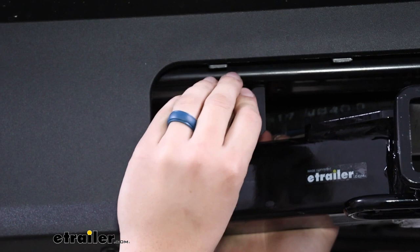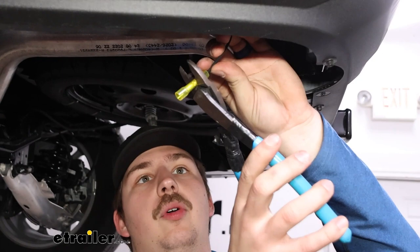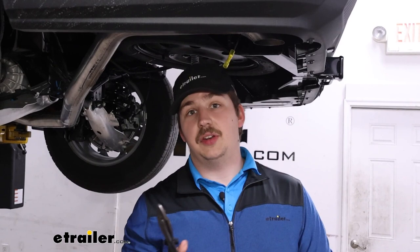Now all we have to do is route our power wire all the way up to the front of our vehicle. For our black power wire, we're going to start by crimping on a butt connector to the end. Your kit does come with some, but I'm going to use heat shrink because that is a more watertight connection — same way we extended that ground wire earlier, making sure that connection is good. Your kit does come with a good length of black wire to extend this all the way up to the front. As a general rule of thumb, avoid any hot or moving parts. Things are a bit cramped in certain places, but we found a pretty nice spot to run it, starting with our box.